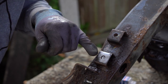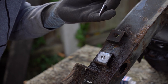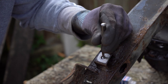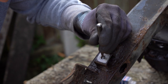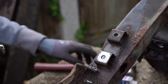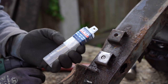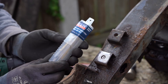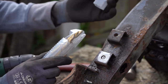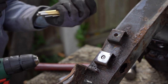Because it's nice and flat, I really don't want to bugger it all up, so I'm going to stop there with that one and I shall attempt to drill it out. Now, I am going to put a center punch in the center, funnily enough, as best as possible. So I am going to attempt to drill it out. Now, these aren't our expensive set of left-handed drill bits at all. Sealey brand, link in the description. So I'll start off as small as the set as I've got.